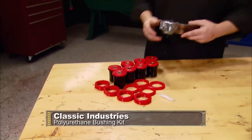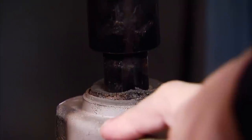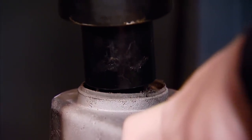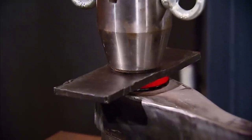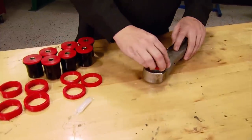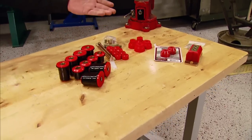We're ready to go ahead and install a new bushing into our control arm. Since we're going more for a performance-minded upgrade, we kept that in mind when we ordered this kit from Classic Industries. Urethane is more durable than stock-style rubber bushings and can stand up to the stress of high-performance driving quite a bit better. It's also a firmer compound than rubber, and when you throw a whole lot of stress on them, they don't compress as much, which keeps the components aligned better. With the thrust washer slid into place, we're pretty much done with this one. You can get these bushings for individual sections of the car, or give Classic Industries a call and they can hook you up with a kit to upgrade all your factory rubber.